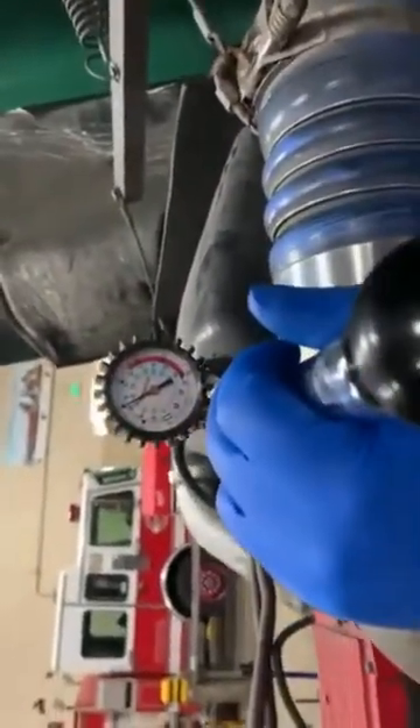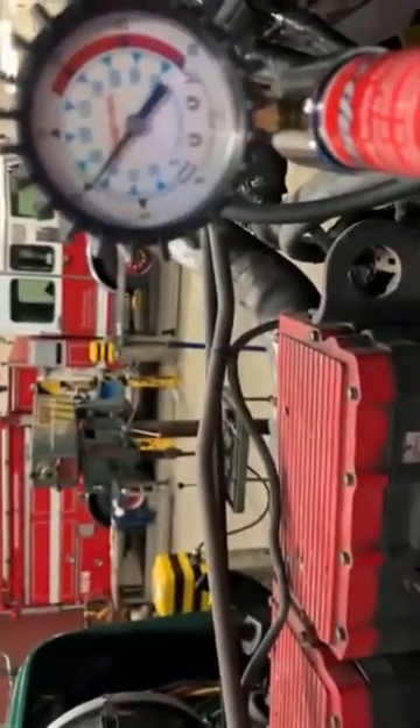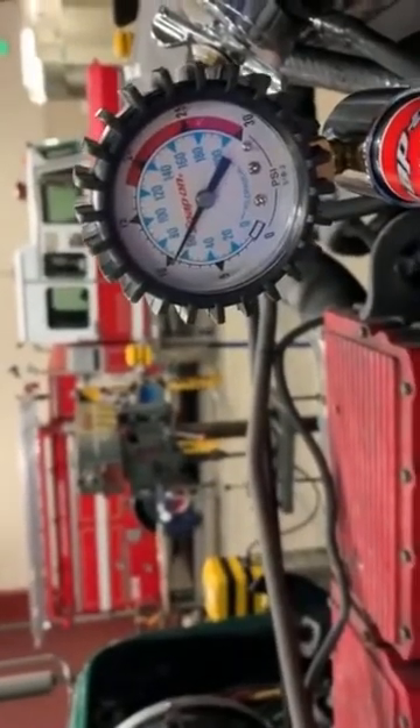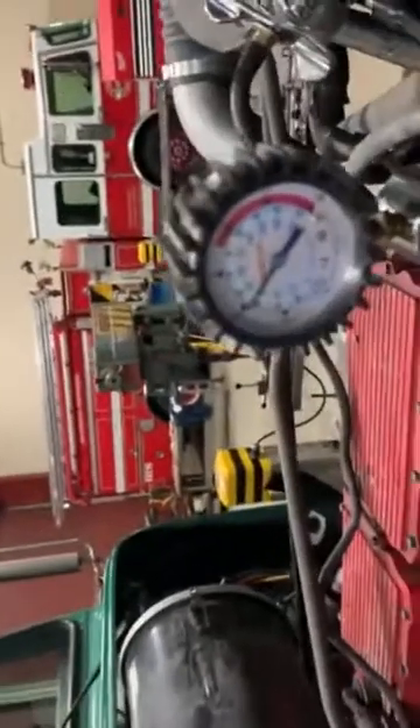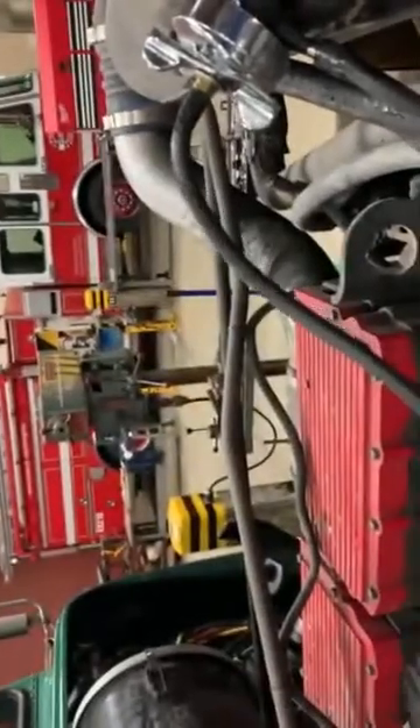I'm going to pump it. Now I've got it to 10 PSI. I'm going to keep it at 10 PSI for at least five minutes or so. Normally we would be doing this while we're doing our preventative maintenance inspection, so at this time I could be topping off fluids. A good habit to get into is to actually check all your hoses while the system is pressurized — go ahead and look at all your cooling system hoses and see if you have any leaks.